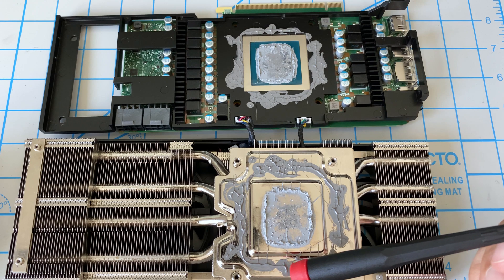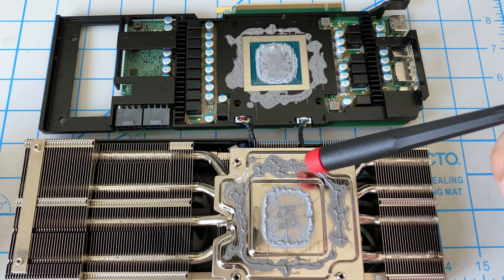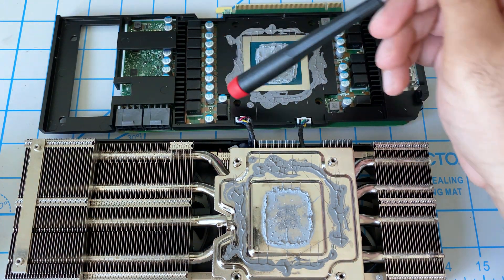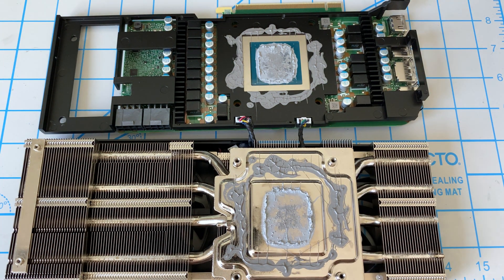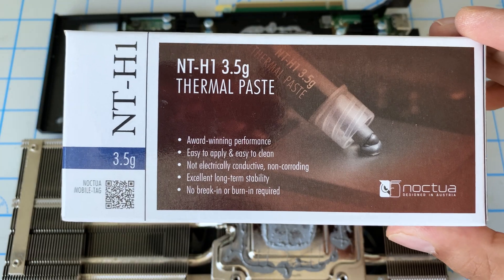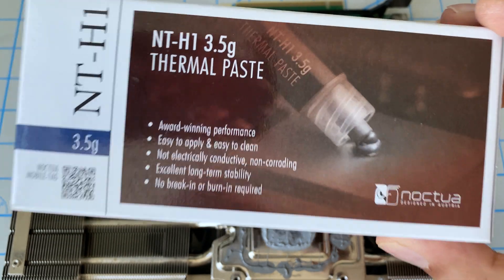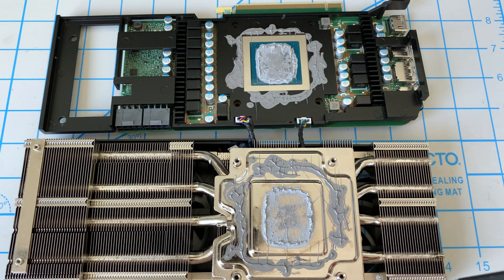The memory underneath has no cooling except for this plate, so as you can imagine under heavy use it starts to overheat. The fix is to remove the stickers from this section — yes, they put stickers which make things worse — then put some thermal compound on the perimeter here, and that allows this massive heatsink to also cool this plate which cools the memory. I've already done that as a test, but now I want to apply this Noctua thermal paste, which has very high reviews. I got it from Amazon and I'll link it in the video description.